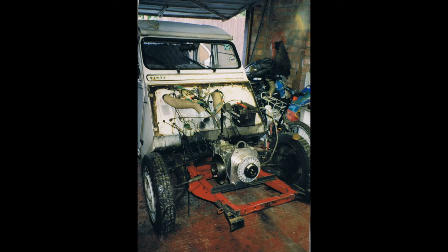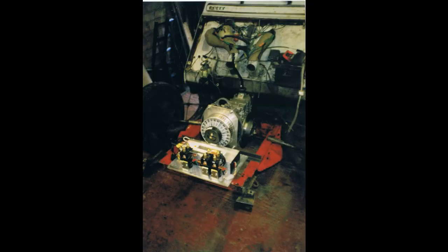There's another view of the front end of the car - you can see I made the mount out of angle iron bolted to the bottom of the plate. The next thing was to work out where the speed controller was going, and this was the one big mistake I made. I thought putting the speed controller there would be perfect, nicely cooled by cool air coming in through the grill. But what I forgot was also the rain and snow and all the general debris from the road would also come in through the grill, and that eventually was the downfall of the car because the speed controller got damp and started to have intermittent issues.